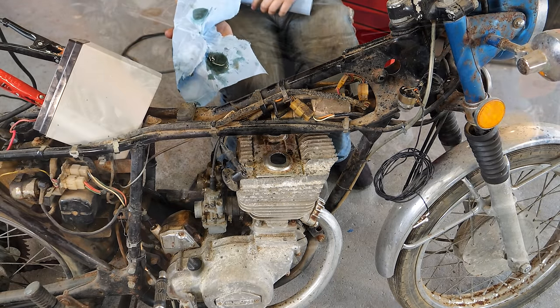So I guess thank you to whoever filled this for me. Hopefully they even charged it, and I essentially did get a pre-filled battery that I can throw straight into this bike for $45. Cool. Unfortunately, whoever did this was clueless. This red hose is to fill the cells on the end of that little tank. This hose is not to be cut.